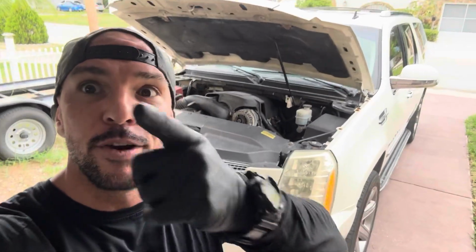Obviously very dangerous. The vehicle that was on the back of the trailer, it was not this Mustang, but another vehicle was on the back of that trailer, and it didn't have any lighting or anything on it either. And I definitely did not want to get rear-ended and end up in a bad situation, not only for myself, but for someone else on there. So I say all this to say, GMT 900s, check your fuses, especially if you have a problem that you can't fix or can't chase up, or you don't know why it's causing that problem. Check those fuses. Later.